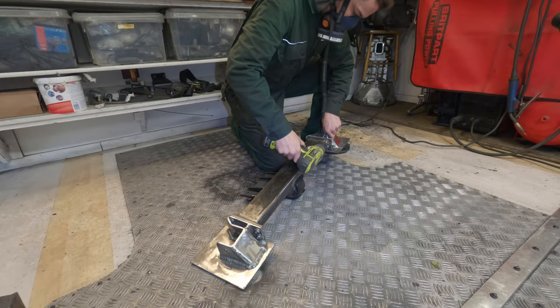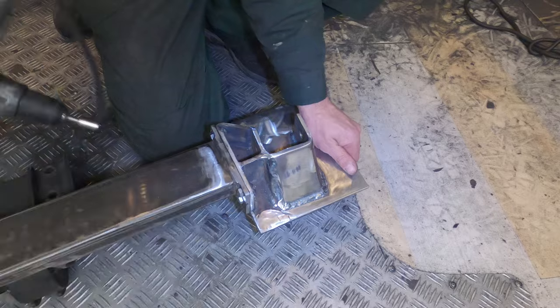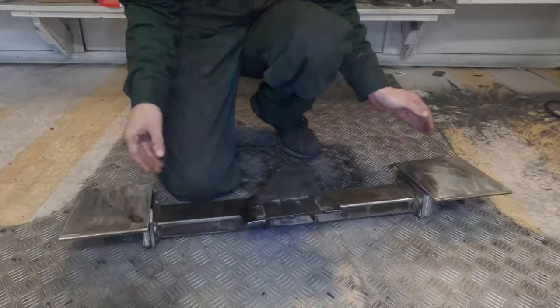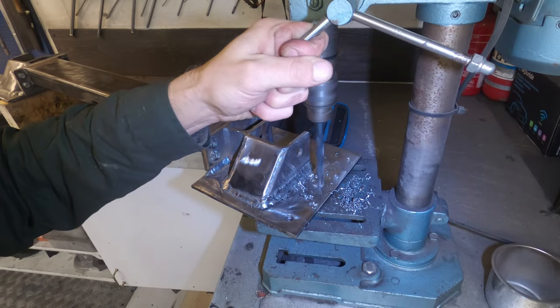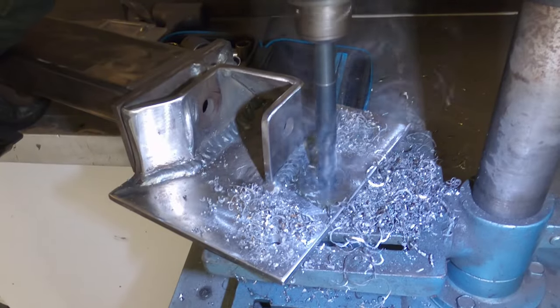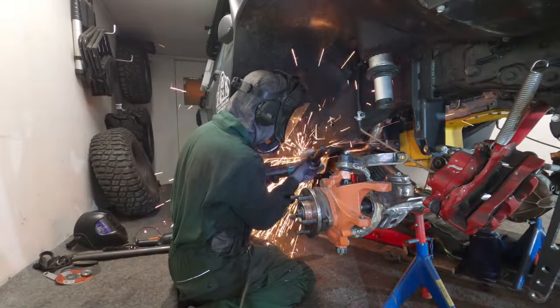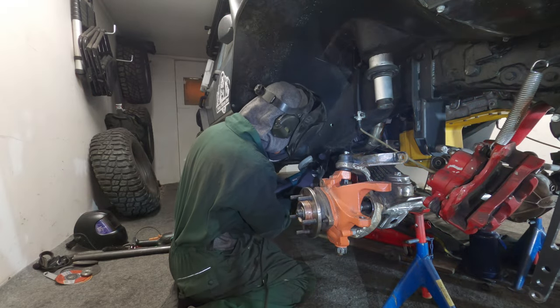It's turned out pretty good — not spectacular, but solid, and it's important that it's solid. It's going to be welded to the Rough Stuff frame stiffeners, so it needs to be able to take a beating. For good measure I'm drilling three 14mm plug welds in each side, so when this thing goes on it's never coming off. But the fun's over — hell has opened up once again and the devil has handed me an angle grinder. This time it's the old control arm brackets.